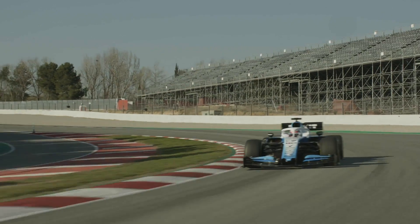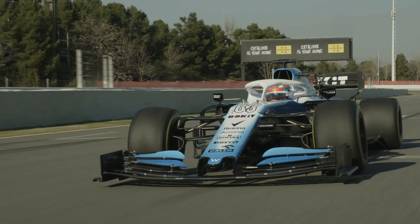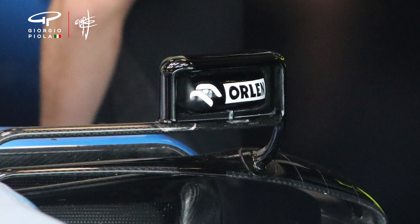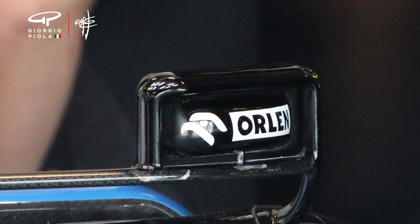Moving to the back of the field — Williams, who were effectively four seconds off the pace today. This is really just housekeeping. We spoke earlier in the week about the team making changes to its car to ensure it was legal when it got to Australia, and we've now had images from Giorgio in the pit lane of what those changes look like. Williams have come up with a brand new mirror design — it's a lot less outlandish than the previous one. They're still using some kind of shroud to manage the airflow; this mirror section creates a low-pressure zone behind it, and the shroud is trying to direct a little bit more air through to negate the amount of drag produced.